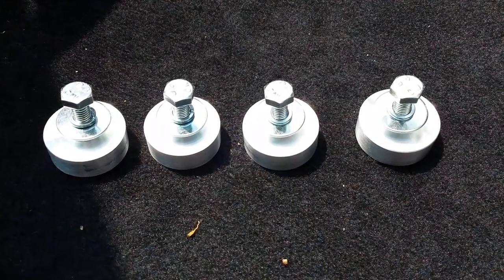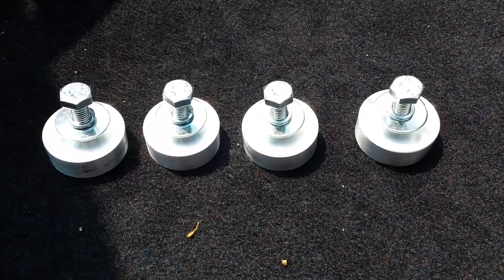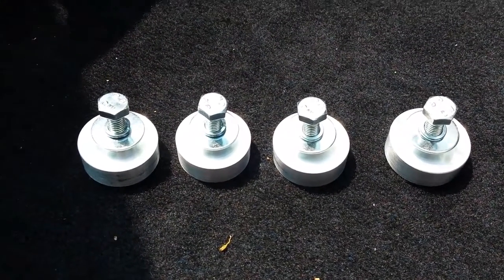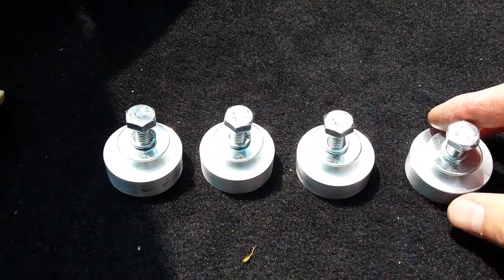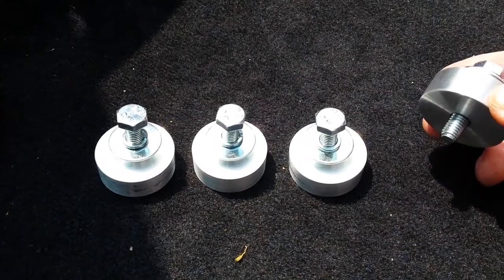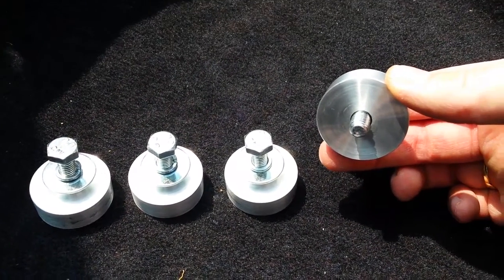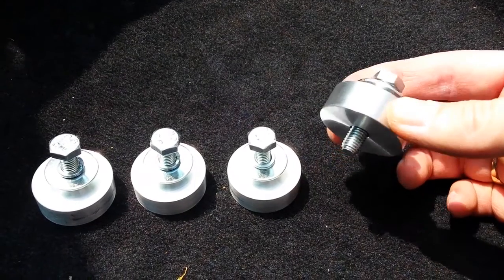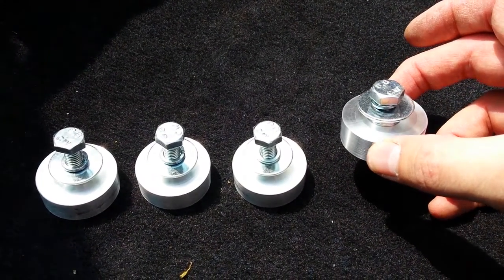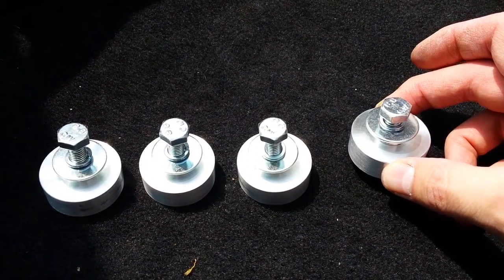I've got a quick video for you today on a recent upgrade I've completed on the MR2 to improve the gear cage. When you shift change, there is a slight bit of play due to the rubber bushings that the gear cage sits on, so I've swapped those out for the ones that you see in terrible slow motion there on the video. I do apologise for that. And they then create zero play in the gear cage whatsoever.